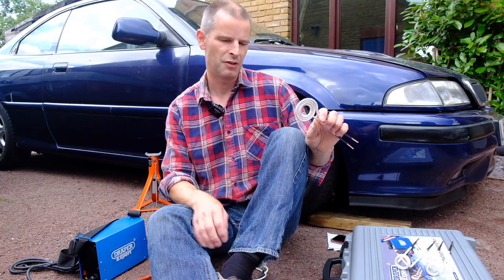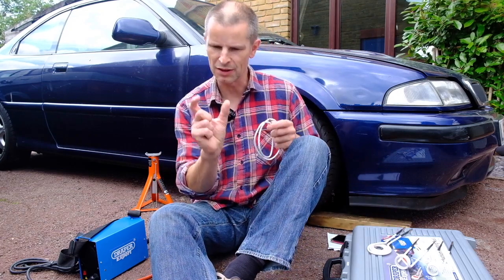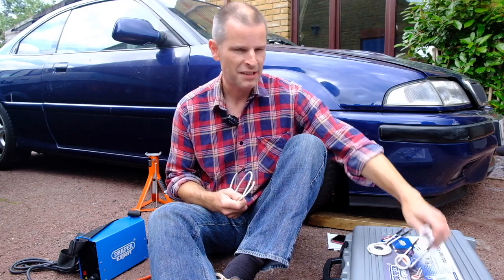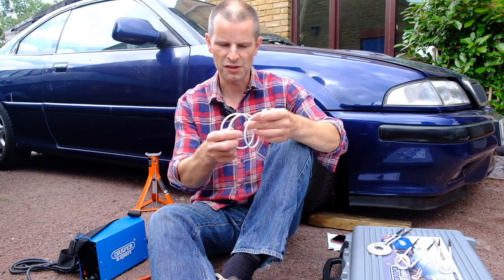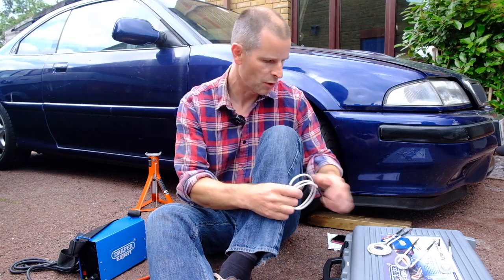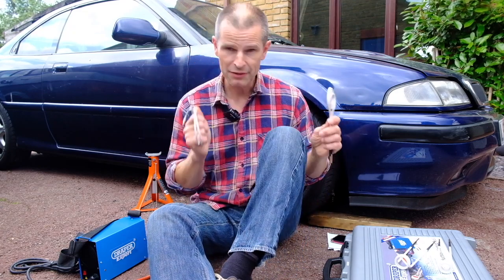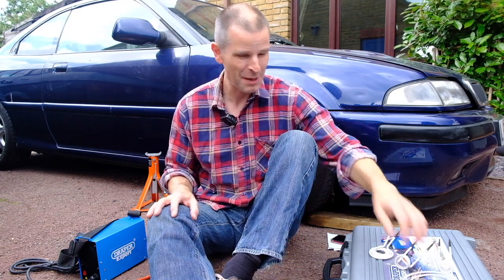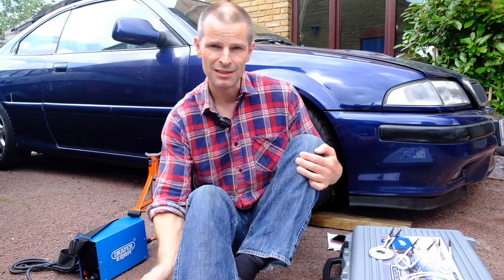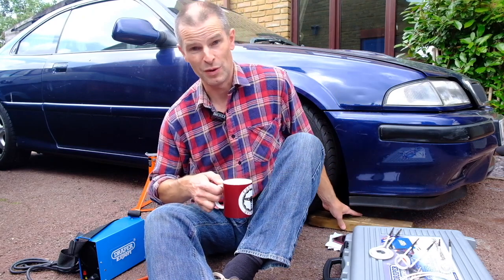There's also one for larger panels, but I'm not sure which one to use. The bolt is quite long and quite deep into the car, so just heating the end might not be enough. This one you can actually wrap around a difficult suspension component, so this might be the one to go for — or possibly this one where I can hold it against the back of the shock tower. So I'm going to have to take the wheel off, have a look, and hopefully in just a few minutes I'll have these shock absorbers free.